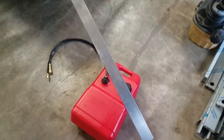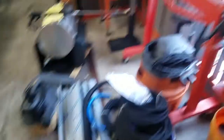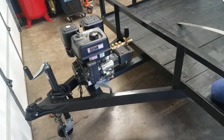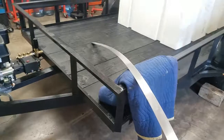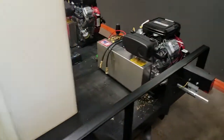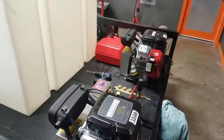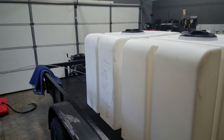Here's my aluminum strips — I'm going to start fabbing the brackets for the tank, and there's my bender right there. Another neat little feature is he wants an additional pressure washer up front that won't be hot water, it'll be cold water only, and this will actually be plumbed all the way to the back. I'm going to fab a tube steel rack that'll go up all the way across here, and then there'll be three stainless steel reels along here — two of them for the hot units, and the middle one for that front pressure washer.